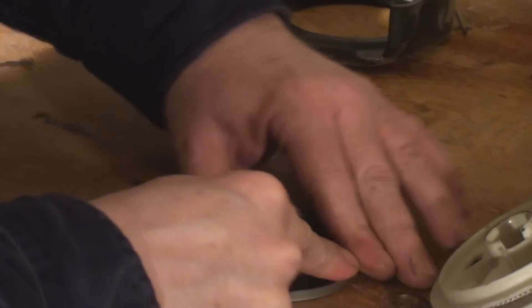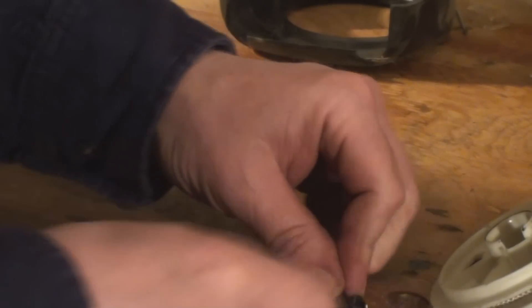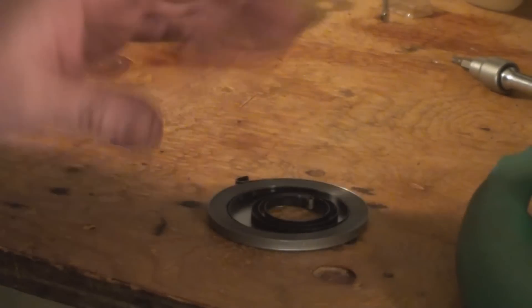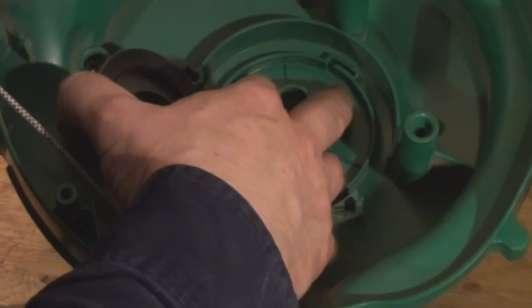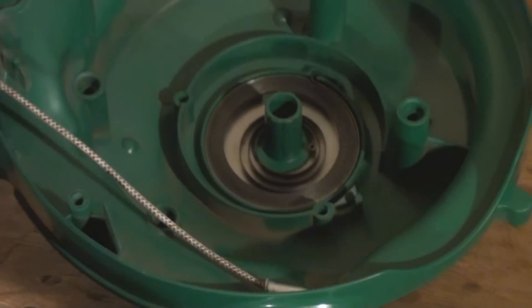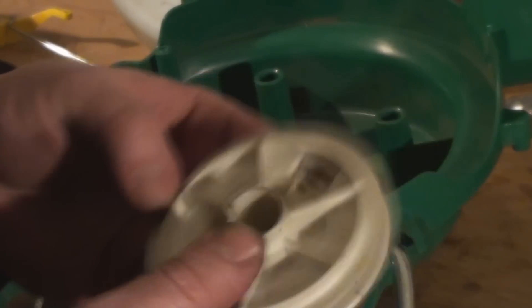So I'm loading the spring into the housing just by winding it in. I'm not impressed with the way this machine was designed. Now, be very careful — you don't want that to jump on you. You can see the tang on this needs to go in that tang slot right there. So I'm just going to drop that in there. There we go. The only thing to do now is to line that tang up. On the back of this reel there's another slot that the tang on the other end lines up to.